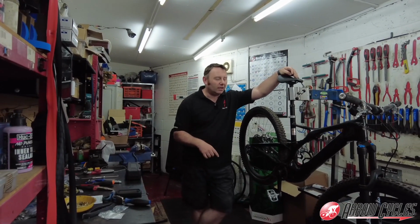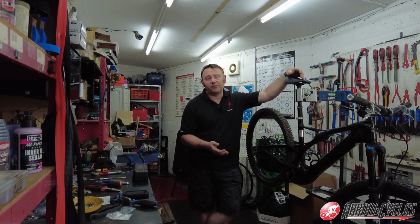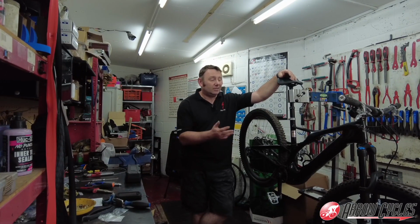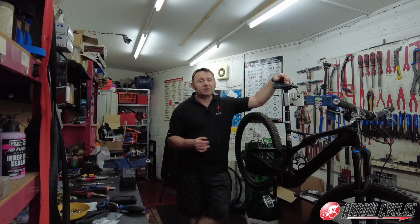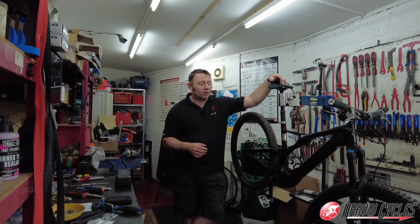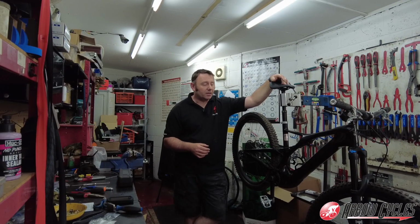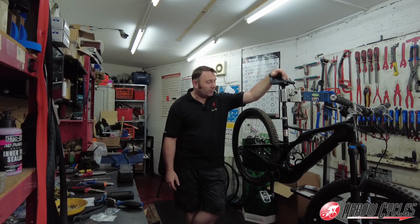We only had one little hiccup, and that was we were going to put a 220mm rotor on the front, and didn't realise that this particular fork is a 160 native, so we're unable to make a 60mm jump, so we've gone to a 200 rotor to make a 40mm jump. Minor things though. Overall everything's gone really well.